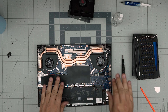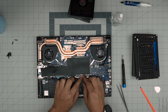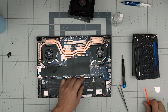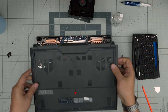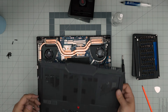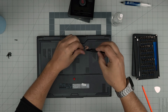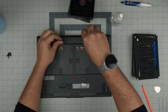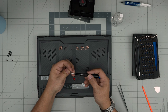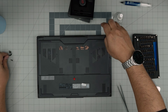Put the heatsink cover back on. The last thing is to grab the battery connector, bring it down evenly over the connectors, push it toward the motherboard, and push the jack on top. Grab the bottom cover, put it straight on, make sure everything is in place — check the cables and connectors — then squeeze the corners and make sure you hear those nice big clicks all down the front and sides. Put the two screws at the back mid, then the rest of the screws go all over. There's a tiny screw with a little thread at the end that goes in the middle.